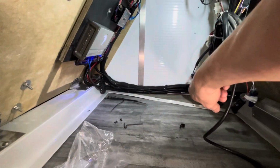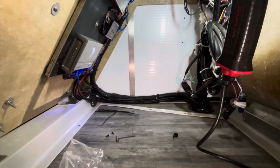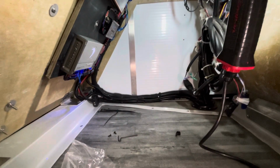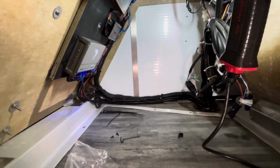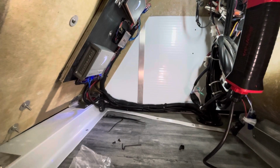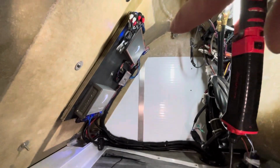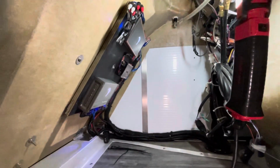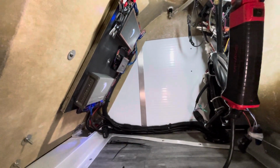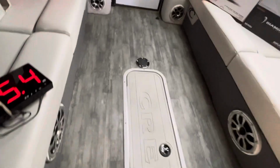All this is our wiring, our fuse block, ground block. We've got full marine Metra V12, 100% all copper oxygen-free cable, 0 gauge, going into a 4-gauge splitter right here, 4-gauge right into the 800.1, and an 8-gauge going right into the micro 88U. So we've got no power supply issues here at all. We've got real wire from the battery here. And let's go over to the wiring here a little bit.